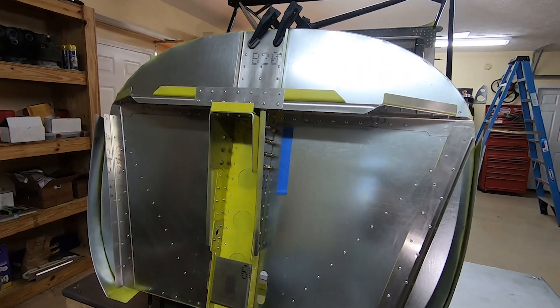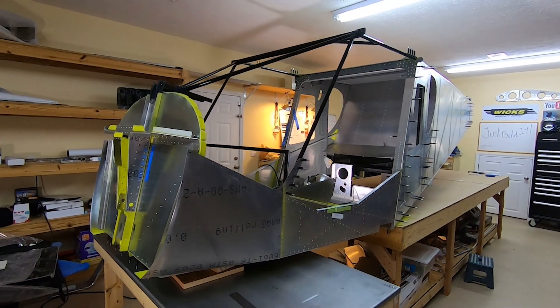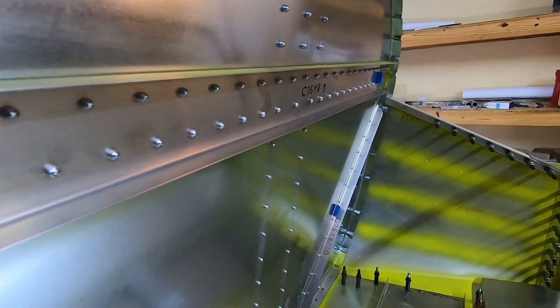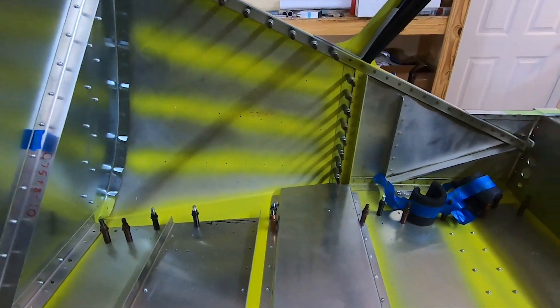As you can see, the firewall is in place - it's not totally installed yet. It's clamped in place at the cabin frame at the bottom belly of the fuselage, but the sides around the side skin still have to be back-drilled through the firewall, which is pre-drilled on the flange side. You back-drill through the skin, then cleco and rivet - that has yet to be done. I wanted to make sure everything was all together and mocked up before I drilled any of the holes, so everything's good and square.